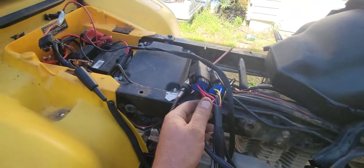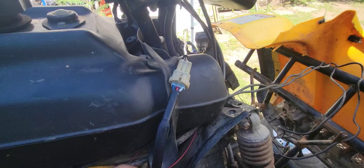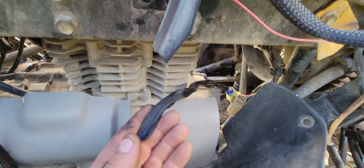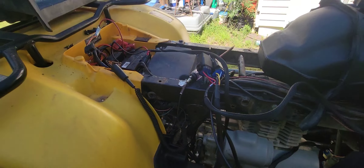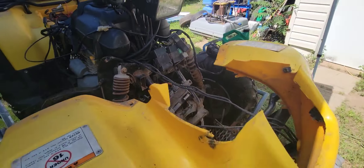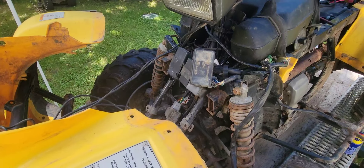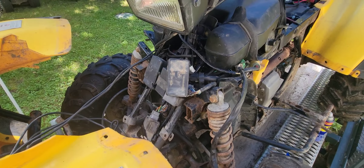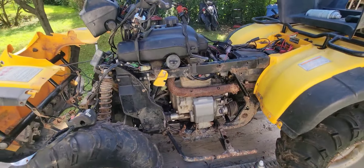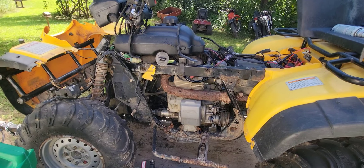The kit plugs into your battery positive and negative terminal, comes over and plugs into your switches and controls, and then down to your shift motor. You bolt all this onto the side of your bike and it bypasses the whole brain box. So don't waste your time looking for an ECU or eBaying one for $250 — it's a shot in the dark. Just order that kit on Amazon for 50 or 60 bucks, plug-and-play, problem solved. Honda Foreman 450 ES shifting problem — no big deal anymore.